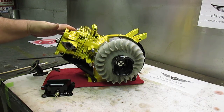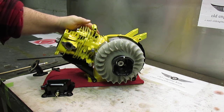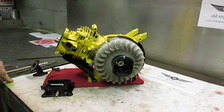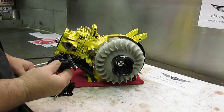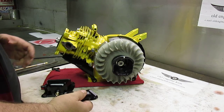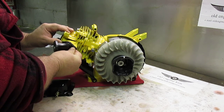Here's the little GX 160 again that we are working on for our mini bike project. In my last video I mentioned we had purchased some performance parts for this engine. One of the things I found is I purchased one of these aftermarket intakes for my Mikuni carburetor, and when I went to install it on the engine I noticed that when you hold it against the block it actually rocks back and forth — this surface on the intake is not flat.